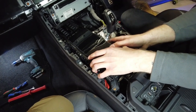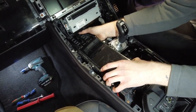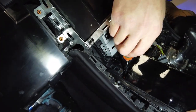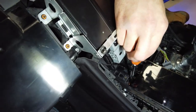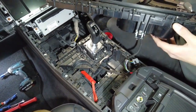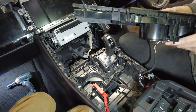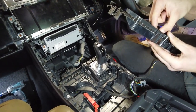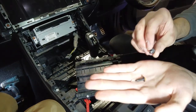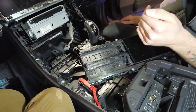There's a connector for the cigar lighter. He's clipped again at the front — you see he hasn't taken that fourth screw out. Youth don't listen! Note: these screws are bigger than the other screws we've taken out — they're Torx T25, a little bit fatter. All the screws for the centre console and cup holder are the same T25. Torx T25 for all we've done so far — they will change in a minute.